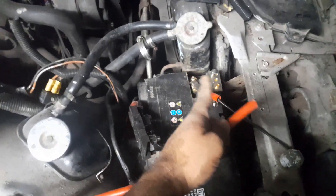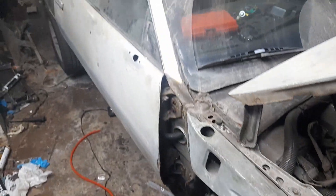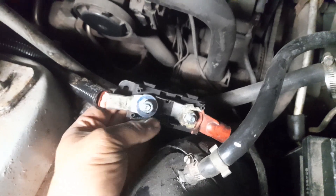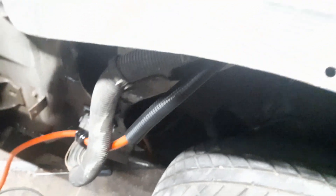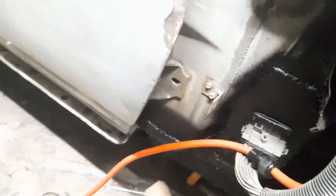The only thing I've got to do now is put a terminal on the end of this and put it on the end of that, then take up the slack where it needs to go. It's not permanent yet, but I'm going to put some heat shrink around there, then put a 300 amp fuse across there, probably bolted somewhere along here or further down. I'll replace this with split conduit all the way out, and then in here where the old antenna hole used to be we'll have this gland, and that can run with more split conduit or along the sill.